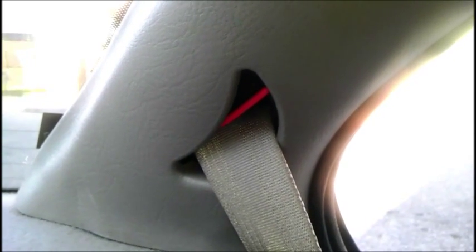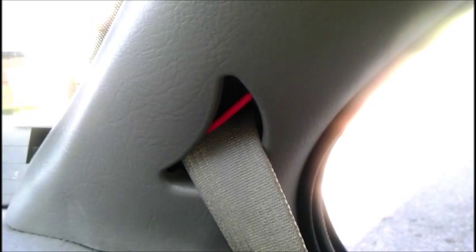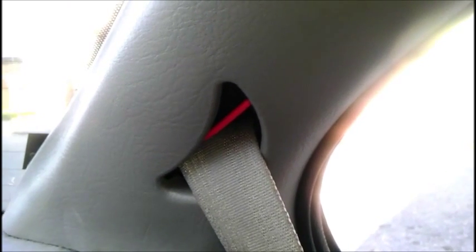Just so you know, when you pop this upper door trim off, you can see my power line — it goes right into the trunk, so you have direct trunk access. I used number 10 wire to help take into consideration the attenuation and all that. What I did was take a combination of stuffing the wire into this upper door trim and possibly some of the headliner. That's why you had to remove all that stuff — it made it easier to maneuver the headliner. Just as a fair warning, if you have to attempt other projects involving this door trim, such as seatbelts, headliners, or sunroof, the learning curve will be extended because now you've got to restuff that line back into the door trim or headliner however you choose to run your wire.